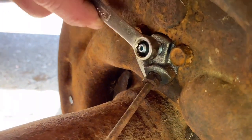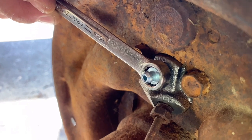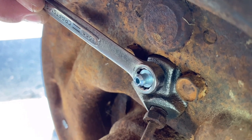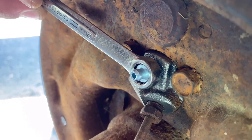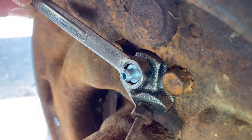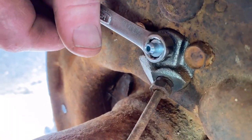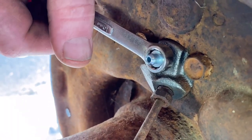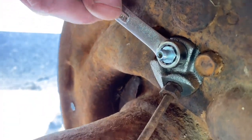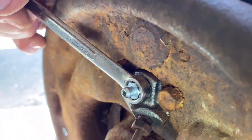Okay, make sure it's free. All right, assistant, go ahead, start pumping. All right, press it to the floor and hold. Let me know when you have it. It's there. So all you have to say is holding. Holding. Oh, got a little squirt of air. Perfect. Pump about 10 strokes and then let me know when you're holding.